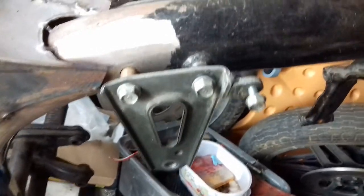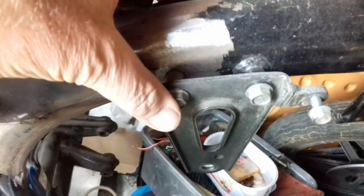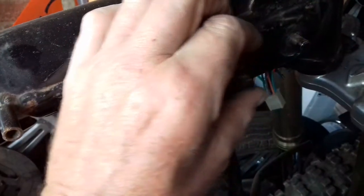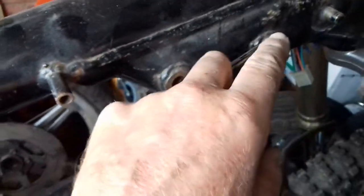I've sleeved that to the rear — there you go. I've sleeved that, so I've just got to run a weld around that on both sides. The awkward thing is, for the other tank which fitted on here, it must have had those big rubbers on and you get those cups on the tank it slides on. But with the custom tank, it has these round bits on.